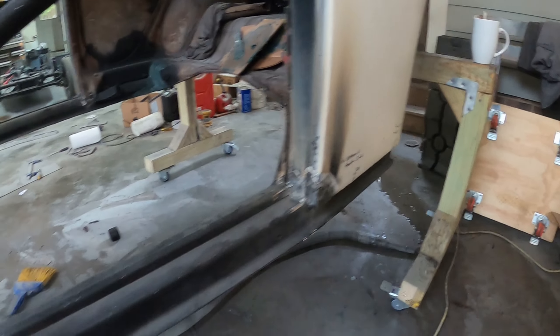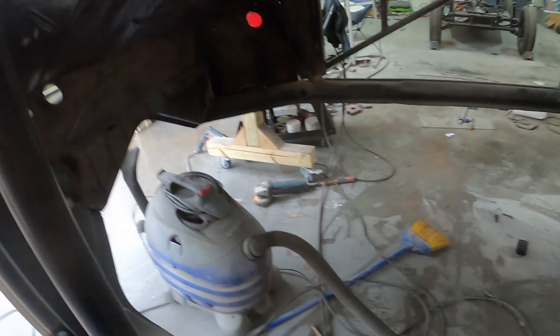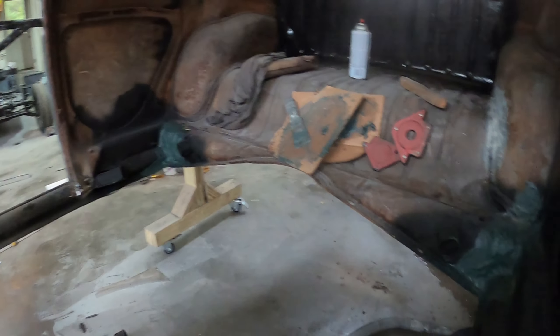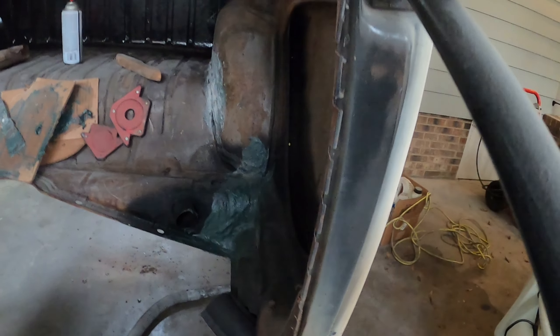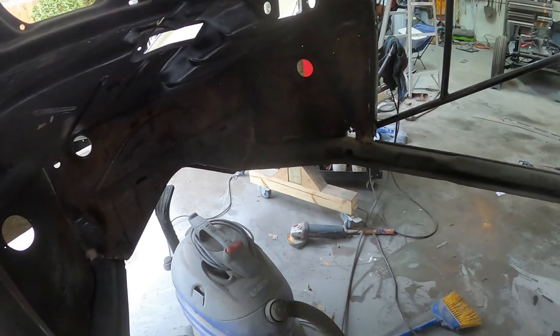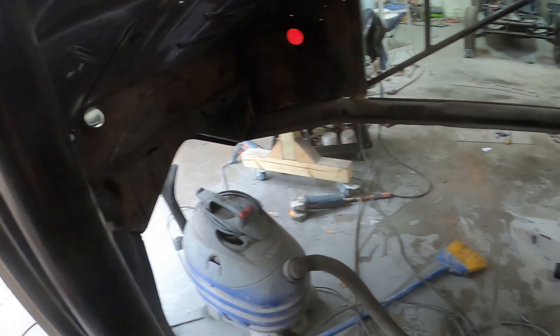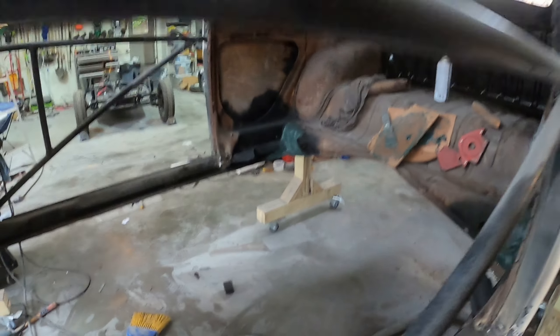I want to finish the main parts of the body that just need repair. I've got to do these two front pillars, maybe do a little bit of metal in here — I need to get in there with a light and check the gaps. A combo of welding some metal and maybe a little more fiberglass bondo, and eventually the seam sealer — which is a more rubbery black stuff — that's going to go all around the seam of the heater channel. I think that should work out well in combination.